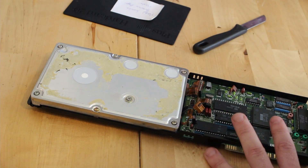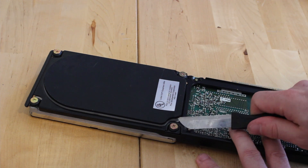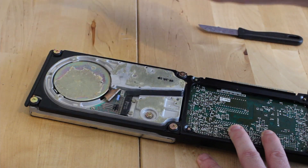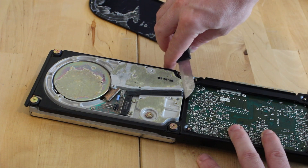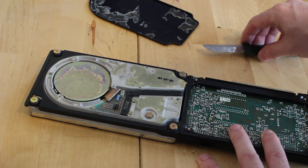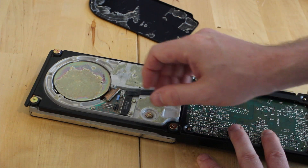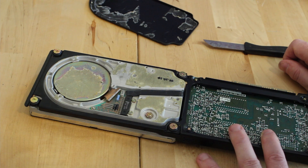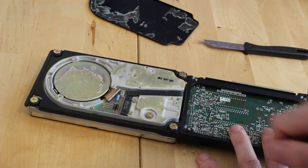Once you remove the screws and nut you get access to the interior of the drive. The underside of the drive is also pretty tricky — this plastic thing has a little lip on it, so you have to lift it up before you can get a knife in underneath to start cutting. You also have to be very careful — there are wires in here, and even a flex cable that you could cut into. This is the underside, and this is the main motor for the drive to spin the platters. Unfortunately you can't get that out from this side — you have to go in from the other side. There's really not very much you can do from this side anyway, except check that the components look okay.